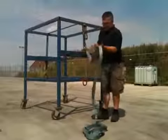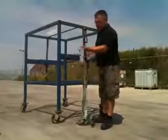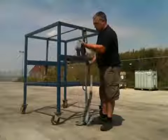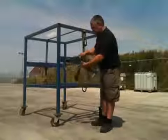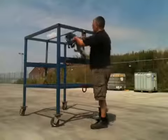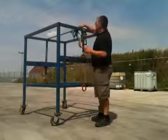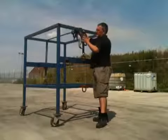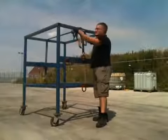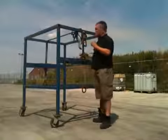Now with the excess strap, we don't have to do it because it makes it tricky, but as long as you actually put it onto the trolley and explain to him competently what you're doing, basically tying it up, and you would fix it against the chock rail or the load itself, wherever it would stay. Again, as long as you demonstrate the competence in knowing that you would not leave it hanging down against the side of the vehicle, you would lock it up against the strap.